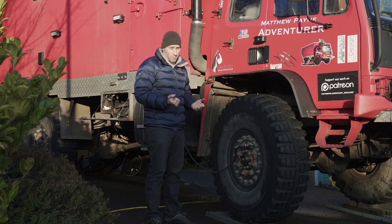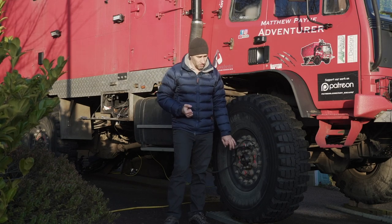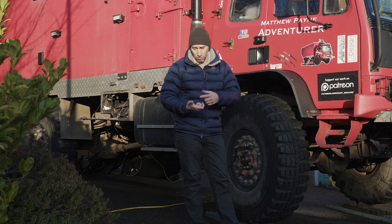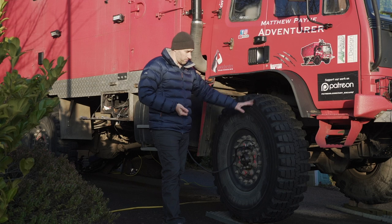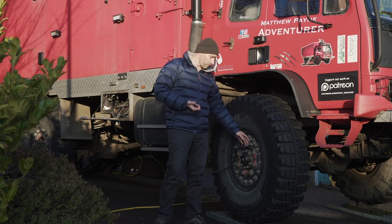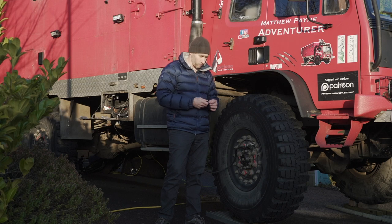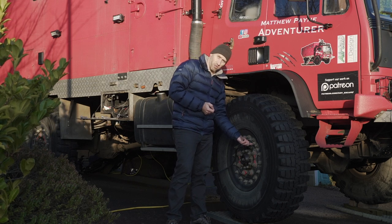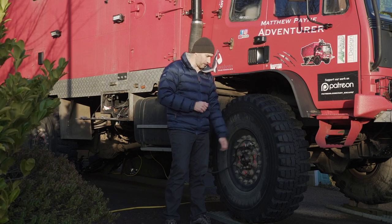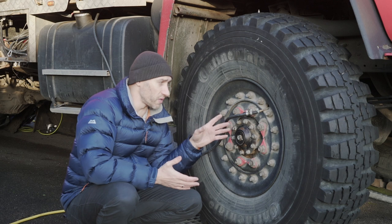It makes life a little simpler and safer. Another option is to get a manual inflator on a long hose so you can stand at the back of the truck and inflate the tire, using a gauge to monitor the pressure. Airing down is not a problem — there's so much air in these tires. I've gotten into the habit of using a tool to back the valve core out to deflate them. You really don't want to stand there with your finger on the valve trying to deflate them — you'd be there for hours.